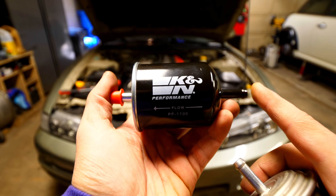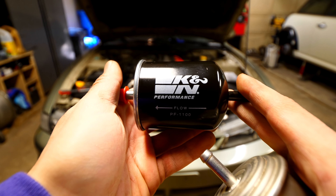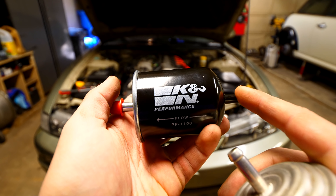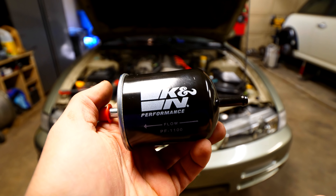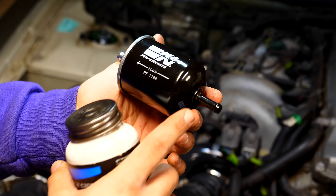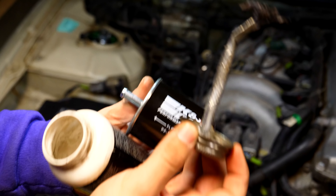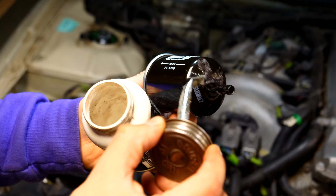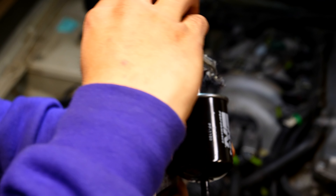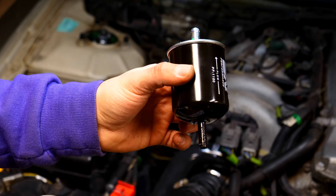When you have your filter hooked up to the car with both lines on it, what I found somewhat difficult is that the hoses attached to the filter were kind of stuck — they weren't rusty or disgusting but they still needed some attention. Using a pick set will help you very much in getting both of those hoses removed. Before we install this on the car, I'm gonna make it easy for us now and later. I'm going to apply a little bit of 3M silicone paste on each one of the nipples on the fuel filter so the lines aren't going to corrode or get really stuck to the filter.